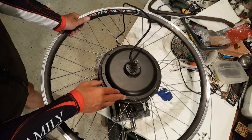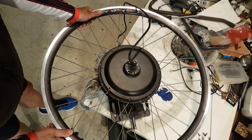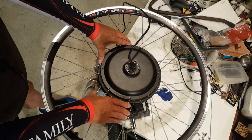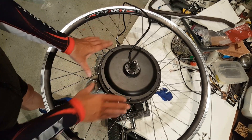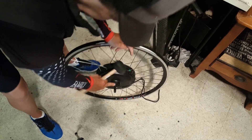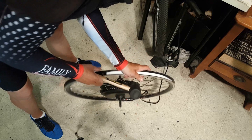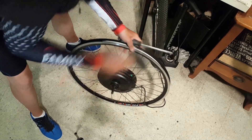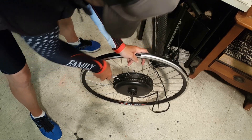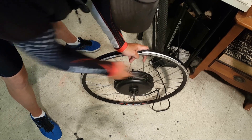Pry this plate off, and then we're going to put it on the floor and start working with the mallet. You want to have a secure working space because it's a pretty heavy motor. If you try to do it on the floor or on the table, it'll just jiggle on the axle — so find a table vise or somewhere you can secure it. The axle is very tight, so we're going to pound with a rubber mallet as it starts to come out. We'll come back in with a screwdriver or a crowbar. What you don't want to do is dig in too deep because you've got your copper wire in there.